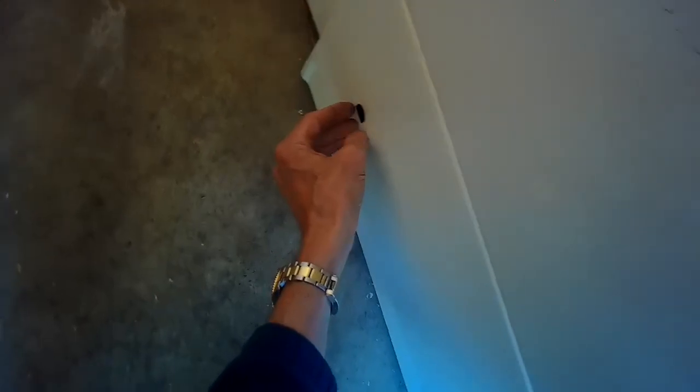And usually there's a little plastic piece right here, and you can just pry it off. So I'm going to press start, and then I'll look in there and see if we see a glow from the igniter. If there's no glow from the igniter, it's either a broken igniter or more commonly a little thermal fuse. Let's see what happens.